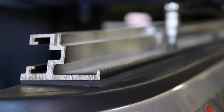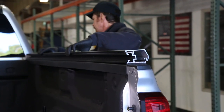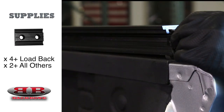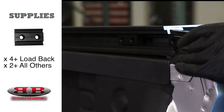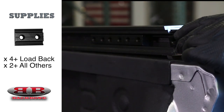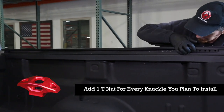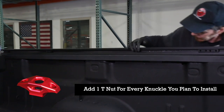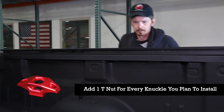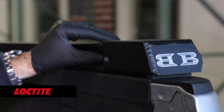This is going to compress the neoprene until the lower rib is actually level. Now go ahead and install the upper rib, and to make triple sure, let's go ahead and check the level one more time. The configuration you purchased will determine how many knuckles you have. It's your choice where you want them, but just remember that each knuckle requires a dually T-nut loaded into the corresponding T-track. If you want any knuckles in the ribs, add the desired amount of T-nuts into the T-slot now. If you purchased a V-back, add two more dually T-nuts into the track now. Now secure your tailbone using a dually T-nut and a taper head screw.